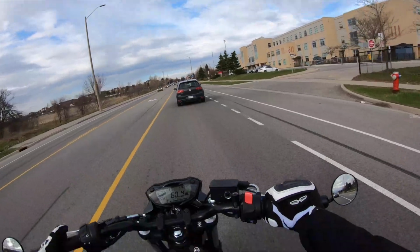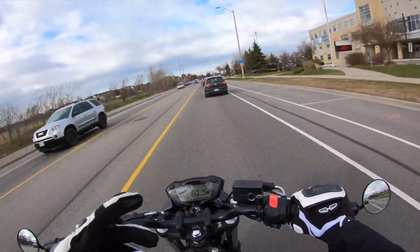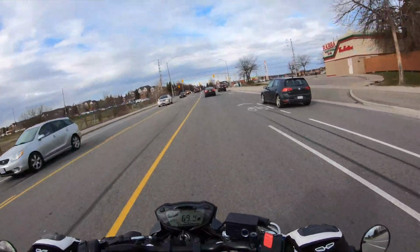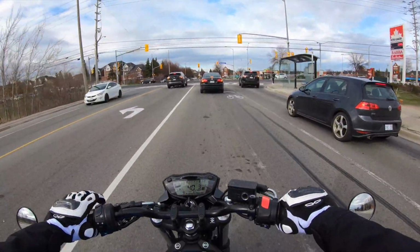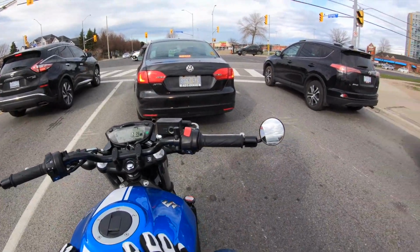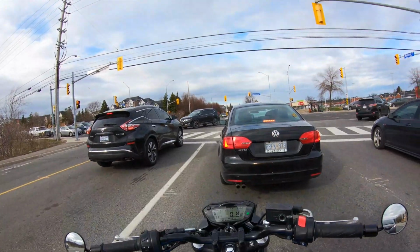And these are a 7/8 handlebar, so standard size. And there's two sleeves, and they're cut so that once you actually tighten it down in there, they should expand. Well, they didn't expand far enough for me to actually get any grip, and they were just falling right out. I actually lost one of the sleeves in the handlebar. I had to tilt the motorcycle on its side and start shaking it. But I got it out, and I didn't drop the bike.